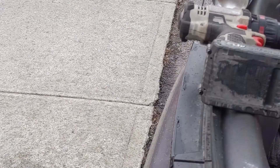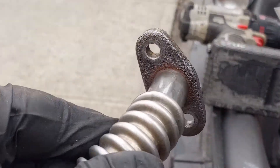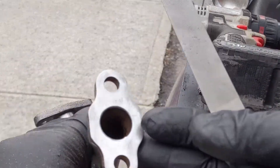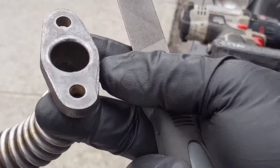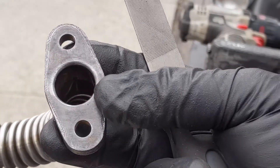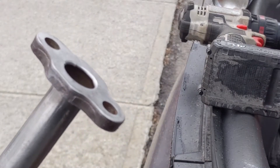After a little cleanup this thing is looking a hell of a lot better - got the old gasket off, back sides cleaned off, edges are nice. The side that goes to the turbo came out a lot better, but if you look closely there are still some imperfections and a couple little bumps. What I like to do is take a flat file and file this side flush, then do the same with the top side - that's going to help promote sealing. I'm going to do that next and then we're going to start draining some oil.